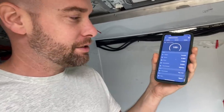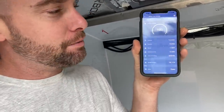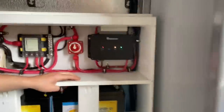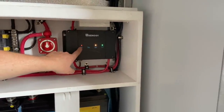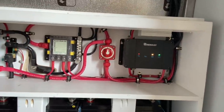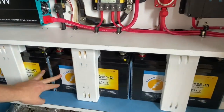I've got the van running. It's charging right now. It's sending 118 watts back to the back, which is 8.05 amps. Everything's looking good. So there's a charging system right there. It's currently getting a charge right now from the alternator. It started off at about 40 amps, so it's since come down on them, but that's just because these batteries are just about full.